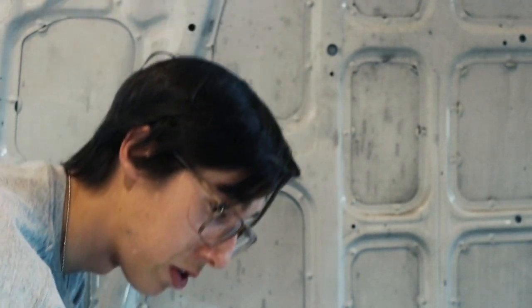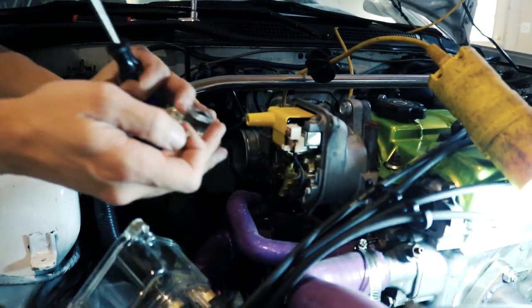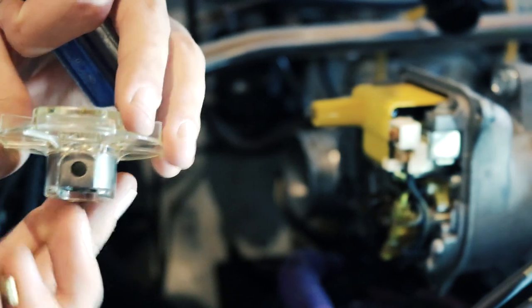I need to crank the motor a little bit. Boys, on the rotor there's just a brass screw — you just have to undo that screw to be able to pull the rotor off. However, it is on pretty tight and it's a pretty soft screw. So when you use this Phillips screwdriver — and that's the only thing you can use — you have to put a lot of pressure towards the rotor so that you don't strip the screw. Because if you strip the screw, you're going to be in bad times, boys. I already got this one out. Rotor comes off, and it's actually shaped so that you can't put it on wrong, and the screw hole will line up right where it's supposed to go.